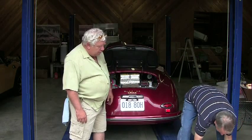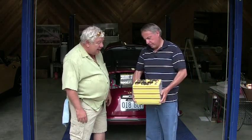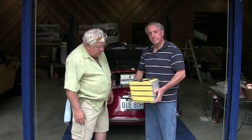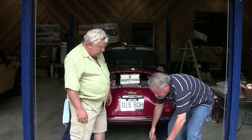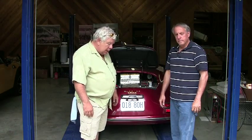These are 90 amp hour lithium ions. And instead of 10, we got 16 of them in the car — they're simply physically smaller. So we put them in two banks of eight each, and that gave us 180 amp hours wide for the current capability.